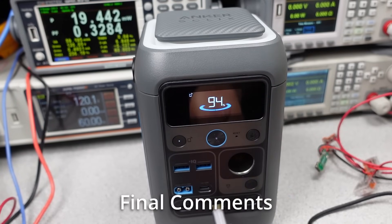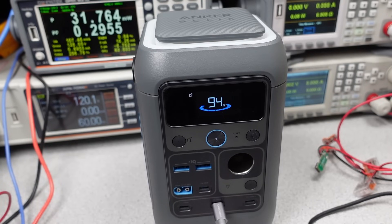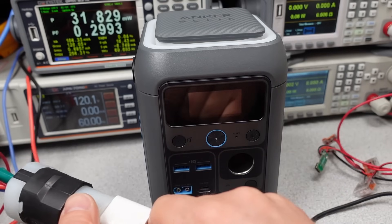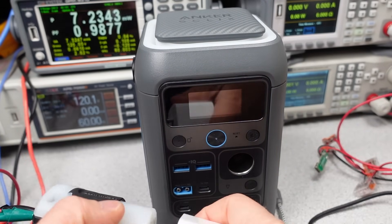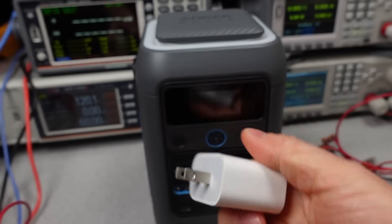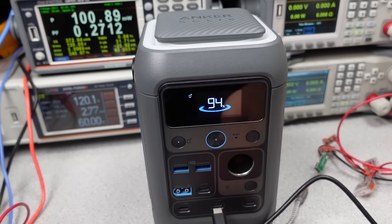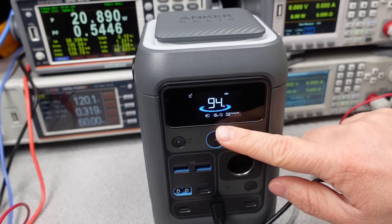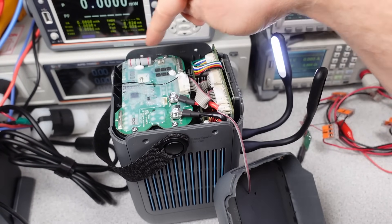It's another power bank — upper average in terms of general performance, which is better than par for the course for newer USB technology. It has longer lasting batteries and a lot of available energy. It can't fly on a plane though, so don't try to bring this through an airport. The reviews really hate the way they included the instructions — tons of paper but nothing useful. The cable that comes with it is e-waste; it should come with nothing. It can charge with two USB-C bricks, though it doesn't support newer USB technology, so the Framework 180 watt adapter is wasted on this device — actually, it gets real confused by that device and forces only a low power mode. It's not waterproof and has ventilation holes on the side, so if you leave it outside and it condenses, it's going to be wet and break. I really doubt they conformally coated the circuit boards — it's not doubt, I checked. They didn't.